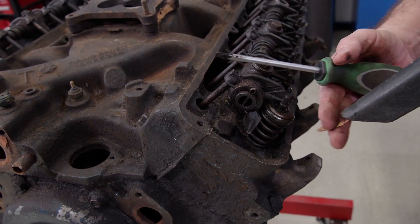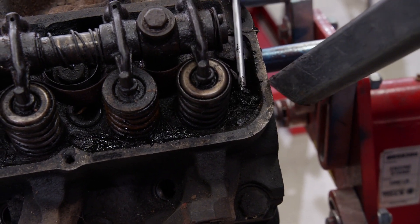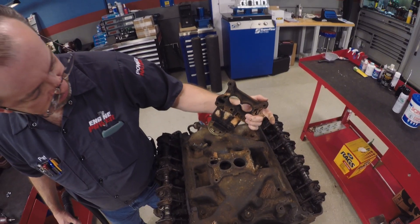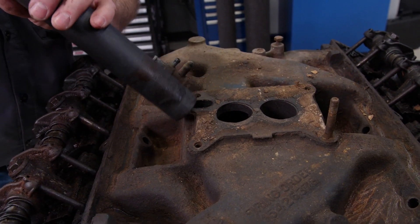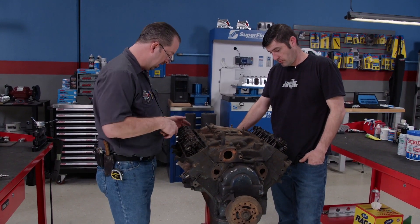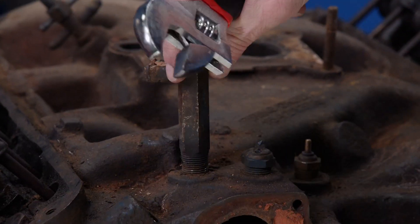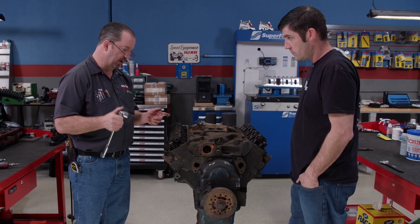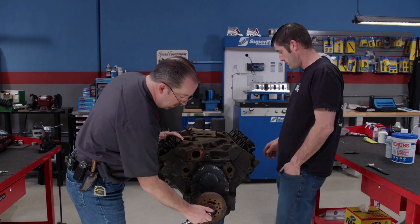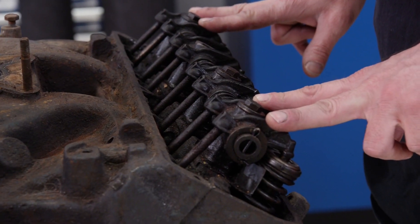Getting stuff running like this reminds me of my youth — there's always a challenge to get one running that hadn't been running before. Half of those were frozen, so you had to break them loose. This one is actually in okay shape. We use the barring-over procedure to check: it actually turns over relatively nicely, valves are going up and down, and we have compression. This lets us verify the engine isn't stuck, that the timing chain isn't broken, and there are no stuck valves.